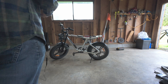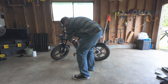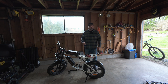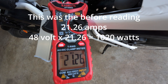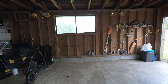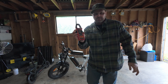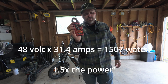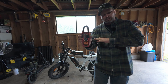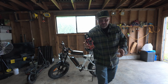Put the batteries back on. Alright, we got the bike all back together - now it's time for the moment of truth, let's see if this shunt mod worked. Oh yeah, that definitely worked! 31.4 amps - so the shunt mod indeed worked. 48 volts times 31.4 amps is what the power level on this bike is now. It's time to set up this shock and bed in those brakes.